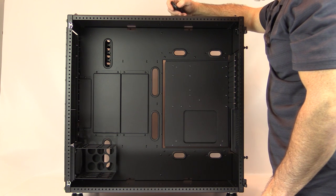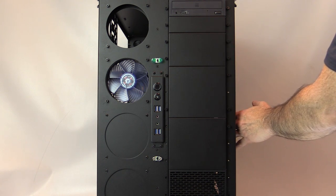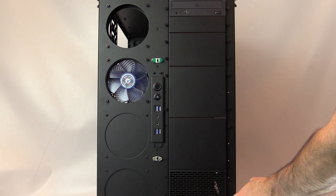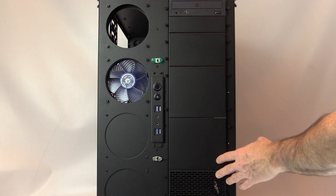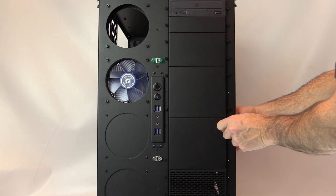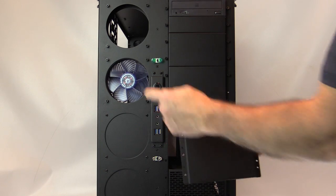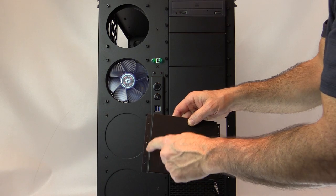On the right-hand side we have the motherboard chamber flex space. The configuration I ordered has solid panels, but you can get ventilated panels and other options such as the Mac 101 tray for the flex bay — a fan plus hard drive carrier. To install anything, you first remove the filler plates by removing the screws on either side and popping them out — they have the same guide pin system as the fixed bay.